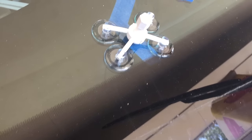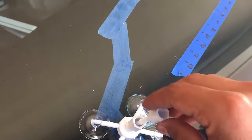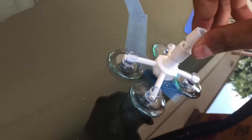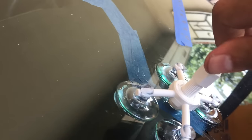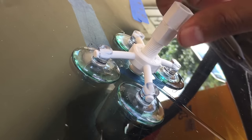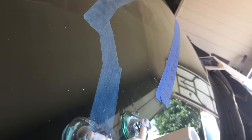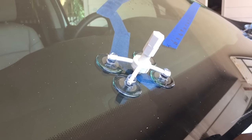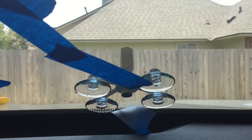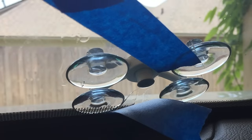I went rogue — I had a little resin left so I set up the injector system. I suctioned the device down centered on the bullseye, screwed the piece in, squirted the remaining resin in, and now I'm putting the plunger in and screwing it down to squeeze resin into the bullseye crack. Once screwed in, you wait about five minutes. Here's a view from the inside — it definitely looks like it made it into the bullseye.